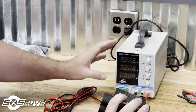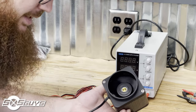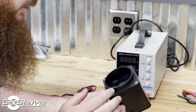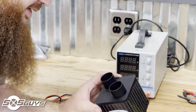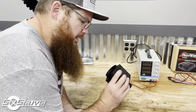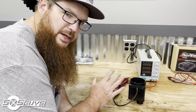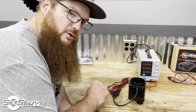You should never put your fingers in the blender, so to speak. You can see how much air this thing was putting out, and it was around a 5.6-amp draw. The fan is rated at 3.4 amps at 12 volts, so it's quite a bit more than that. This is the original with the carbon fiber shell. There's a new version with a plastic body and a whole new fan that has better airflow characteristics at about half the price — go check that one out, but this gives you a good reference.